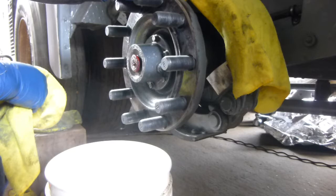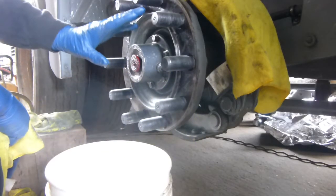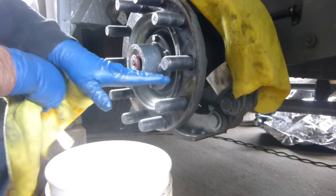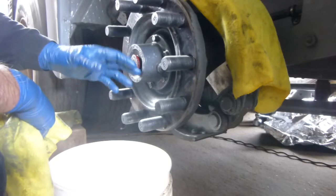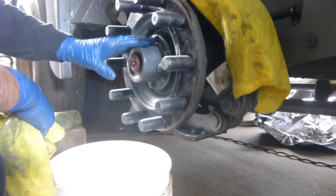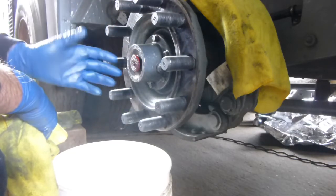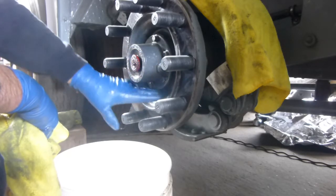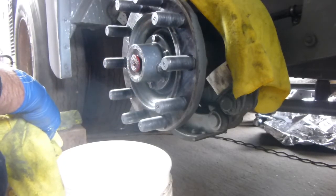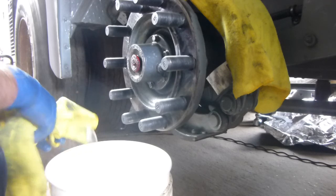So anyway, the other side, I'll get into it more when we get on the other side, rather than just try and explain now. I just want to tell you that this side has been off. I've repacked the bearings, I put it back on, I filled the cavity between the bearings, I filled it up with oil right up until it was starting to run out. I say oil, I meant gear oil. And it started coming out where the bearings are. So now I'm pretty sure there's got to be oil in this cap to let it go around and slosh in the bearings at all times, rather than just that little bit of oil that's in the cavity, because there's no way of getting it out of that cavity. But you've got to have the cavity for a volume of oil inside of the wheel here. So anyway, this is where it stands, this is what it looks like, and you'll see me tomorrow what I'm doing over there, okay, on the other side. Thank you for watching.